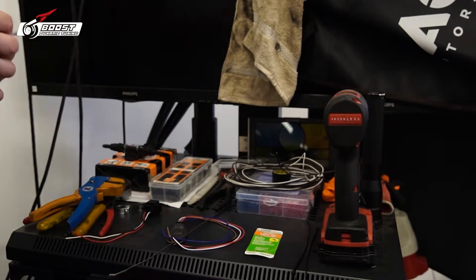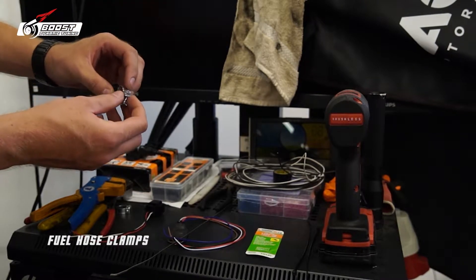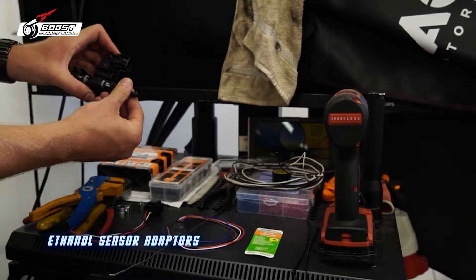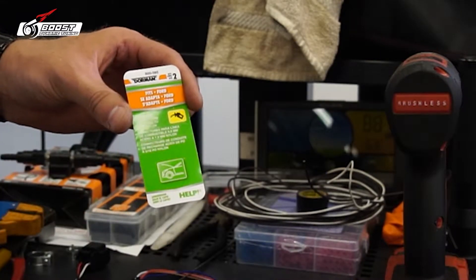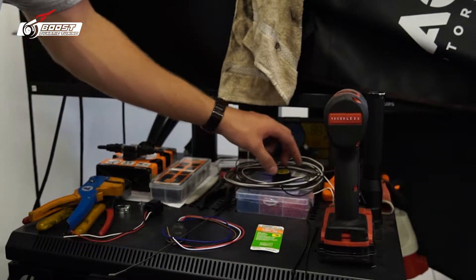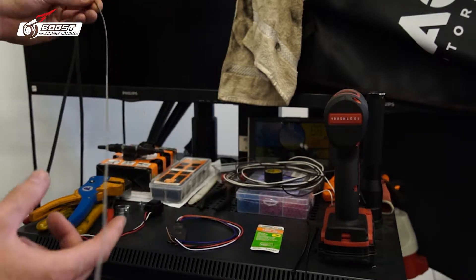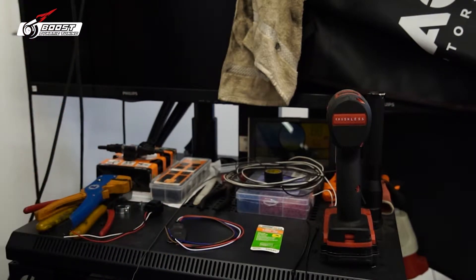Here's the tools we're going to need today. The biggest thing to note is I'm using these fuel hose clamps — the other ones seem to back out on my B8.5, backing out every three months. We have adapters for the ethanol sensor — here's the part number in case you want to order them. Other than that we have wire shielding, shrink tube, a plastic trim removal tool to get to the P3 gauge, terminals, electrical tape, wire, and a metal hanger to get the wires through the firewall. We also have crimping tools to remove the shielding.